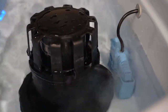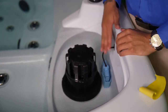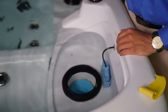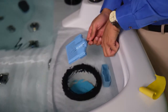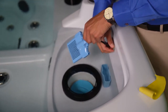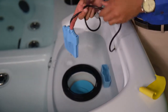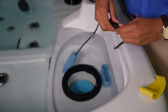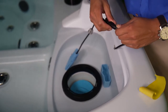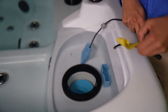For regular maintenance you're going to want to replace your filter and cell block. Remove the skimmer — it's not required but we're showing it as an example. Pull gently on the cord and remove the grommet by wiggling it back and forth very gently. Pull on the cord, grab the connector, and twist it off. It will disconnect pretty easily. It's important not to get the cord wet, so use a piece of tape to hold it down.